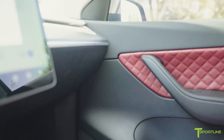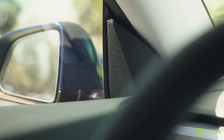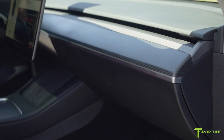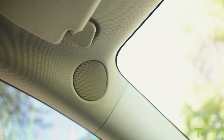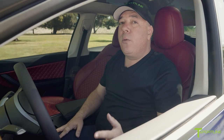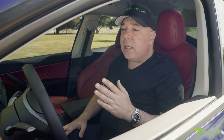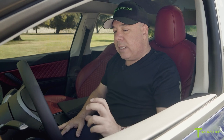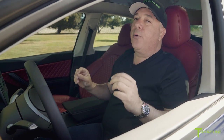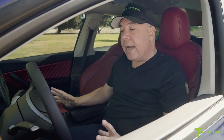Now let's talk about the speakers. In the front two doors there's a 6-inch driver by Tesla — we replaced that. The tweeters in the A-pillar corners we replaced, and two out of the three 3-inch speakers in the dash were replaced as well. We used a product made by Focal — arguably the greatest car audio speaker manufacturer in the world, extremely well known in home audio and professional recording studios. The Flax series lineup is definitely above average, extremely musical — you get great mid-bass from the 6-inch in the doors, great mid-range and vocals from the 3-inch in the dash, and excellent higher-end frequencies from the tweeter in the A-pillars. It all looks factory — we didn't cut anything.